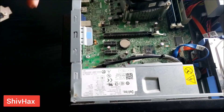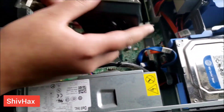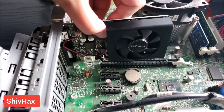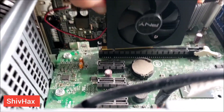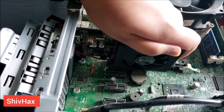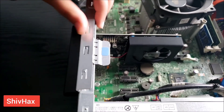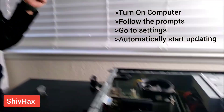So it's locked in place and now you need to open the latch and then insert it right here like this. Make sure that it will fit in and then you just need to press it down little by little like that. So it fits right over here and it's nicely secured and now you can close the latch. And now our graphics card is installed.